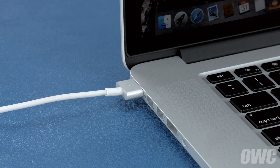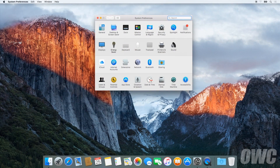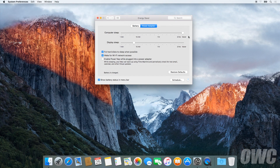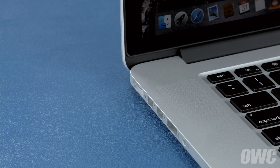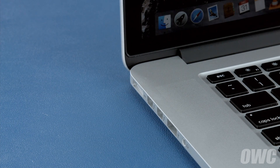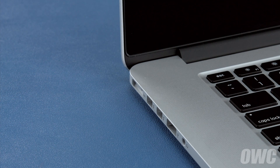After that, we'll need to discharge the battery. In the Energy Saver preference pane, make sure all the sliders are set to the right and any power saving measures, like sleeping the hard drive, are turned off. Do this for both the power adapter and the battery settings. Once you've done that, disconnect the power cable and let the battery discharge completely until the computer shuts down. You can still use it at this time, but don't do anything particularly heavy — steady and even usage will result in better power system calibration. Once the battery is discharged, your computer will automatically shut down. Leave it shut down for at least five hours to ensure the battery is completely drained.